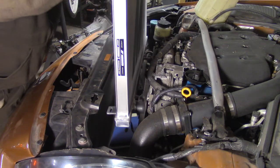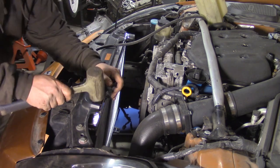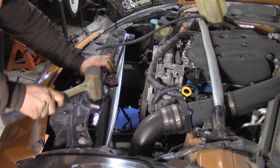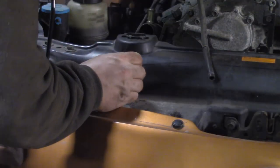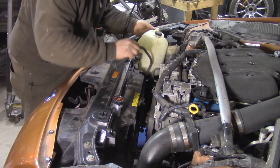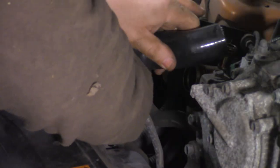Take the factory trash from Nissan and throw it in the garbage. Reinsert your much larger, much nicer Mishimoto unit — some violence may be required, maybe a lot of violence. Reinstall the fan shroud, reconnect your coolant overflow tank, and reinstall the upper hose and tighten the hose clamps.